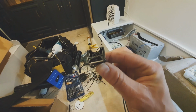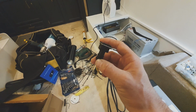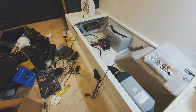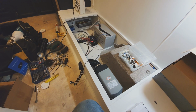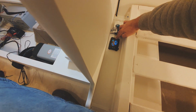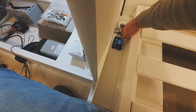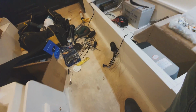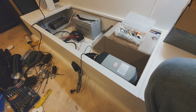So I'm going to just cut this line and feed the line down so the hole's not so big, and then splice it onto the car, under the Caravan. I mean, the reason why that's on is just because I've just hooked up to the battery straight up, but it's not doing anything. I don't think it even turns on properly. Oh, it does. Oh no, error's out, no fuel pump connected. Yeah, I'll drill that hole now, and then inside the Caravan's done for the diesel heater. Just got to do outside.